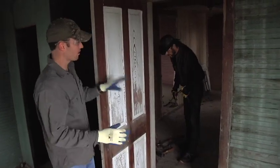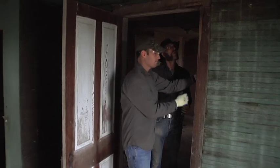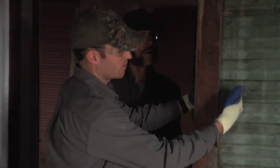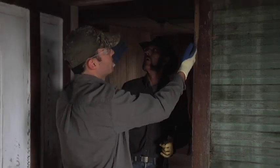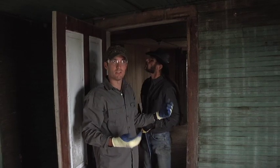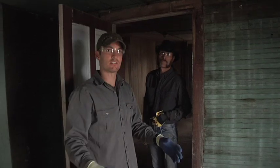Now that we're taking all the hardware off, Farad's going to be on the outside beating through where the jamb and the wall boards are. He's going to come in with the crowbar while I'm leveraging here, and we're going to take this outside nail line out of the trim that's fastening it to the wall. We're going to be able to pull this jamb out as a whole with the door attached, because it's cheaper and easier to do that now, keeping it all together and intact.